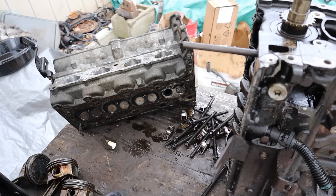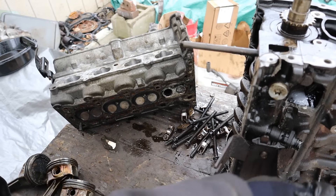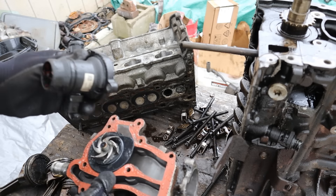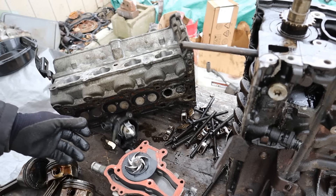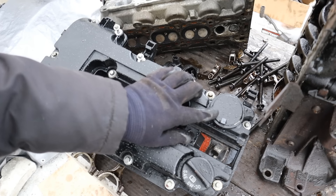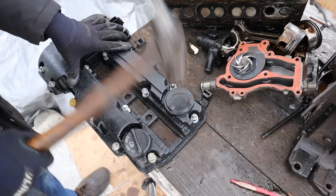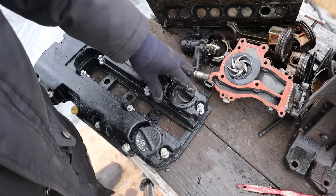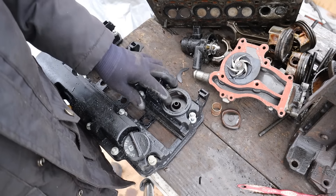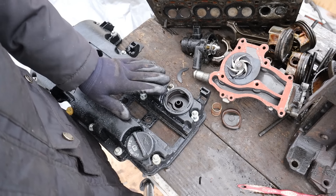Now there are other problems with these engines such as the positive crankcase ventilation system. The turbocharger that sits over here — especially the wastegate — likes to go. And anything to do with the cooling system such as these plastic components, elbows, water pumps, thermostats — you name it, it always goes on these cars. Now this valve cover has already been replaced, likely due to the positive crankcase ventilation diaphragm inside of here. And that's the cover and this is the diaphragm that always likes to go — you can see it's made of rubber and of course there's a spring inside of there. This is all integrated inside of this plastic cover, which means that you've got to replace the entire thing when it fails.